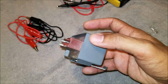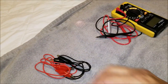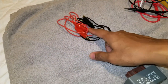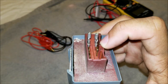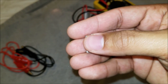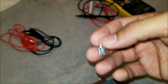With the main relay removed, we can start the second test. This involves testing the continuity within the main relay, and for that you'll need a multimeter, some alligator clips, and your main relay. To make this easier, I personally use female wire connectors — 14 to 16 gauge — and I take off the plastic piece on top, pop it right onto the relay pin, which gives a nice surface to clip the alligator clip to.